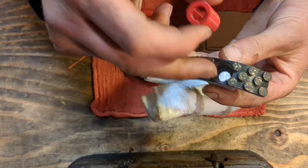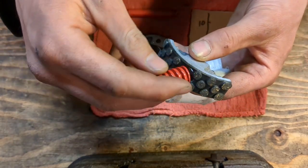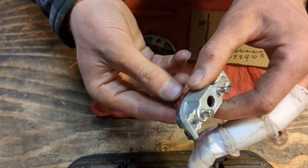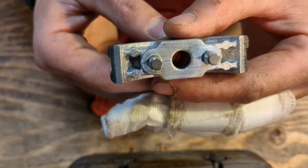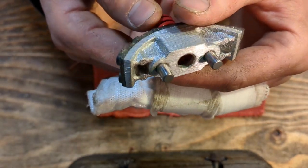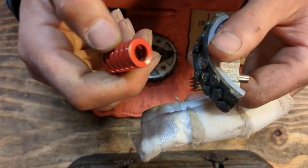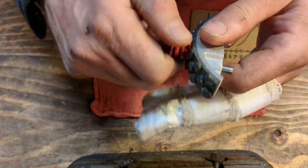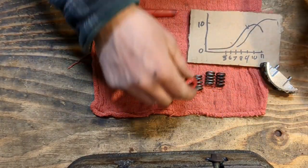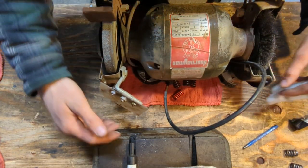Like I said, this is cast aluminum, and cast holes are tapered holes. So at the top of the hole, it's going to be one diameter. Bottom of the hole, different diameter. And I can't get a caliper in there to actually measure that. But this guy doesn't want to actually go all the way down due to the paint and a little bit of material size differences. So, way to solve that, very easy. There, grinder. That's how you solve this problem.